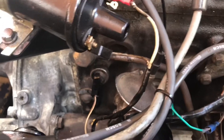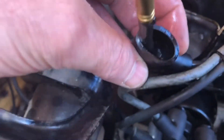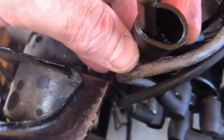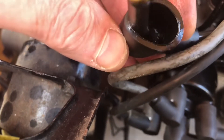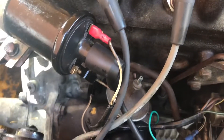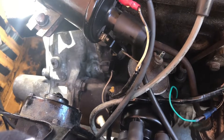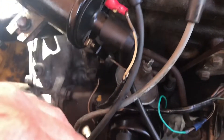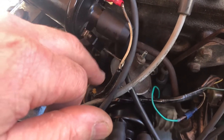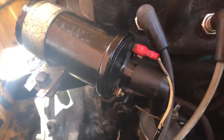There's plenty coming out. I'm wondering whether I just soaked it to death and that caused the issue - certainly very wet with WD-40 in there. Just flipped the cap off - see how wet the interior of the king lead is. I thought WD-40 was a good thing but I don't know. I've pulled all the leads off, checked them, and other than the king lead being very wet I've dried it all off and rerouted them all so they're all pointing slightly downhill now, just in case any remnants want to drip out.